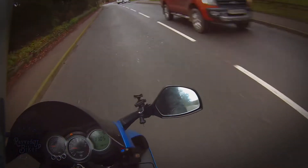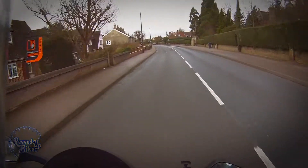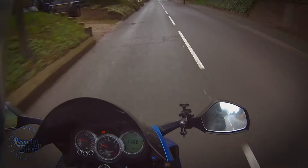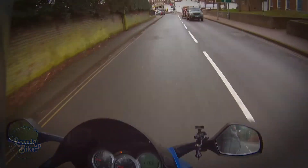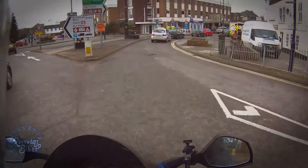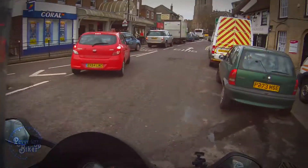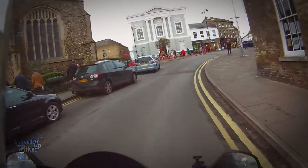As soon as the bike seems to get warm, you switch it off and then switch it back on again - it then drops. 12.4. So that's not charging. I'm now probably eating away at the battery. Just filled up and the petrol light is still on - I think I haven't got something plugged up. We're at 12.3 now, we're in dangerous territory. 12.3, 12.2, 12.3, 12.2.